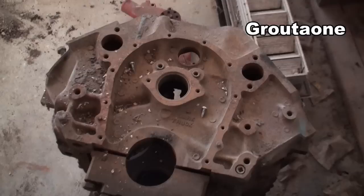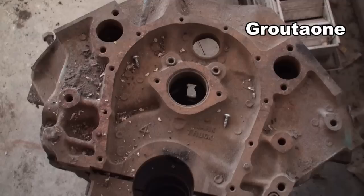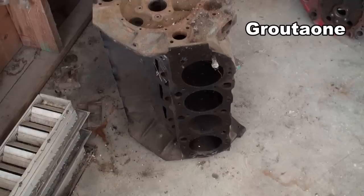The nice thing on these tall decks is for stroker projects, typically as the crank gets bigger the rod also needs to get longer. And so that means the piston needs to go up higher — once that wrist pin runs out of room up underneath the ring lands, this tall deck starts providing room for all that to keep it all in perspective.